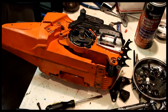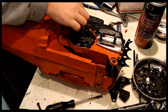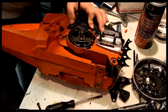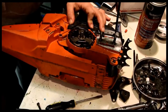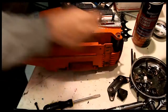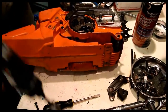Short bolts, 4 of them. All going with grease. They probably don't need lots of. That's good for torque. Perfect. Chain brake's ready. There were a few random screws here that go down. I'm not exactly sure what these are for. These are more positioners than anything. You'd think that they'd go into rubber AV mounts, but they don't.